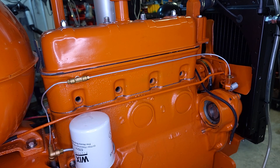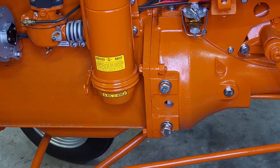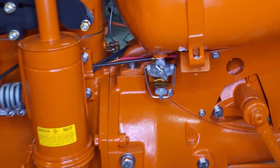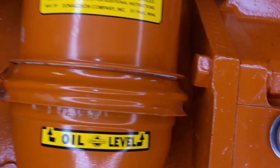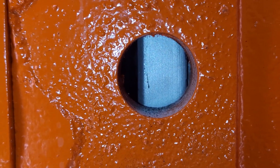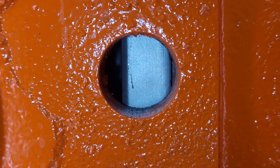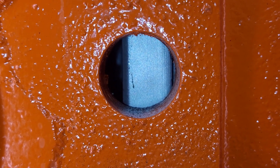There are a couple of things we're going to look at. I'm going to show you the timing marks before we bother setting top dead center. Where we look for the timing mark is on the left side of the bell housing — there's a hole. Inside, sometimes there are accessories bolted over it and you may have to remove those, but we can see the silver flywheel in there. Now I'm going to spin the engine over by hand and show you all the marks.